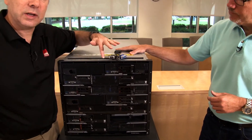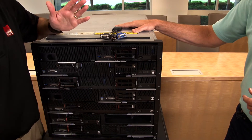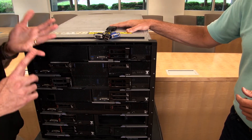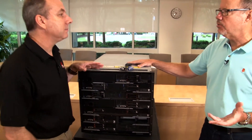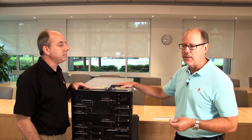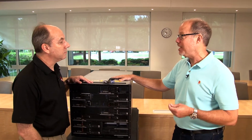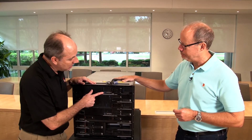The SN550 is a half-wide form factor, so you can fit 14 of them in the chassis. The main components in the middle are the two drive bays — these are hot-swap two-and-a-half-inch drive bays, and we support SAS, SATA, or NVMe depending on the backplane you've selected. You can select HDDs, SSDs, or NVMe depending upon the performance characteristics of your application. These two-and-a-half-inch devices are getting more and more capacity all the time, so you can get a lot of local storage in these products.